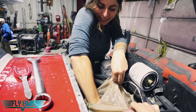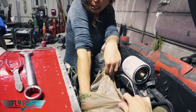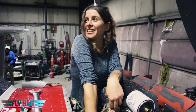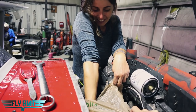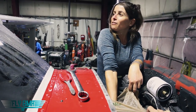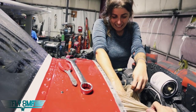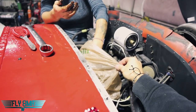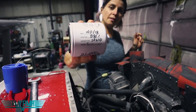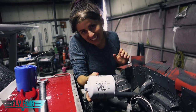Step two is to close off the drain and start removing your oil filter to replace it with a new one. Typically we remove and replace the oil filter with the cowling on, but for demonstration purposes it's best done with the cowling off. Locate a big one-inch wrench that will fit on the back of the oil filter. Before you try to crank on it and break it free, clip the safety wire that's holding it in place. Once you undo that safety wire, wrap a big plastic bag around the oil filter as you're loosening it — break it free with the wrench first, then right as it gets loose and is about to start dripping oil, slide your plastic bag around it to catch all the oil as you remove the old filter. Then write the tach time and other information onto the brand new oil filter. It's for the center engine, not left or right.